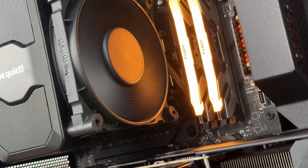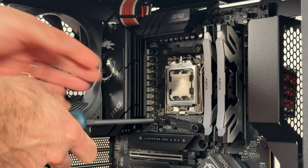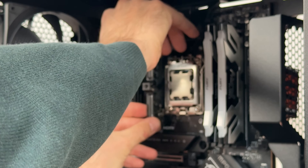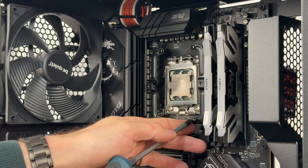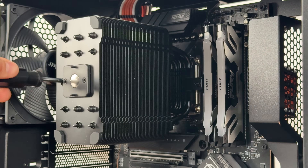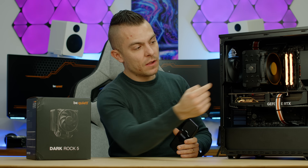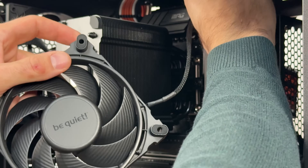For the mounting mechanism, it has a really easy process. For AMD specifically, you remove the original retention bracket — four screws and the retention brackets from the motherboard. You place four plastic standoffs and on top of them place the two retention brackets sideways, making sure the threaded part is on the outer side of the CPU. Then use four screws to tie up those retention brackets, apply thermal paste, remove the foil from the CPU block, and place the cooler on top. One screw goes through the heatsink from the side — tighten it evenly. The cover is magnetically attached, so there are literally no issues removing it; just get used to the strength of the magnet because it holds quite nicely.